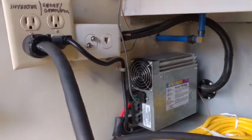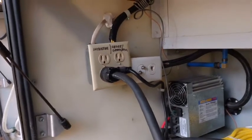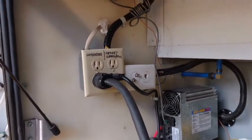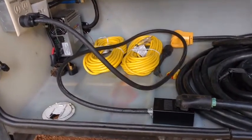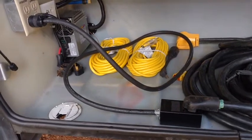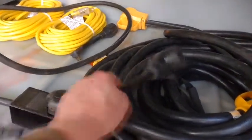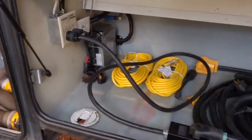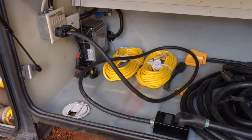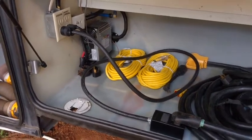I don't have anything to remember. You might not need quite such a long piece here, or you can even wire it direct to the big plug if you have a different arrangement. I like this because this piece I made also serves as a 50 amp to 15 amp adapter, and since I have 15 amp at home I use that all the time — it eliminates the need for two adapters: 50 to 30 and 30 to 15. I've stayed many places where they only had a 15 amp plug and you can just plug into that and run an extension cord — don't even have to pull out your 50 amp cord. It kills two birds with one stone. Hope it works for you.